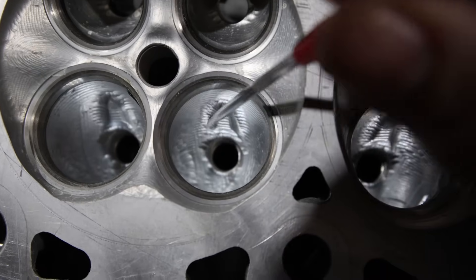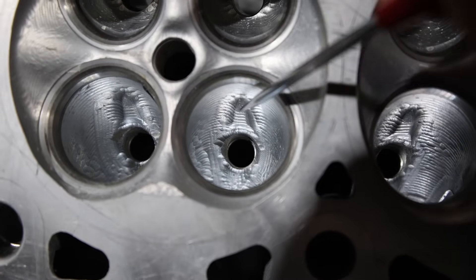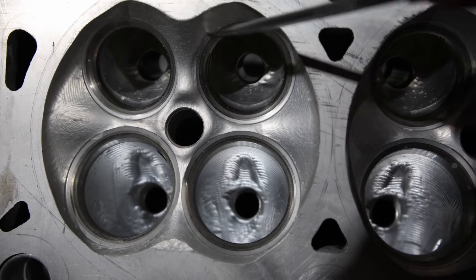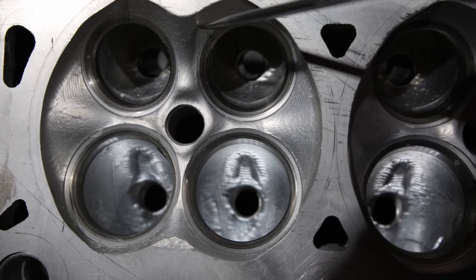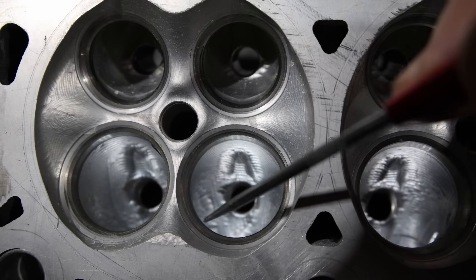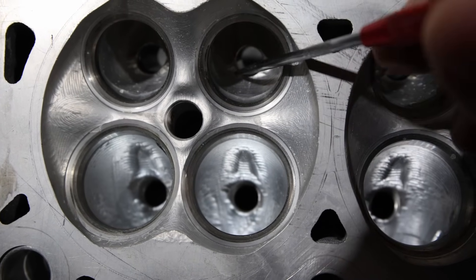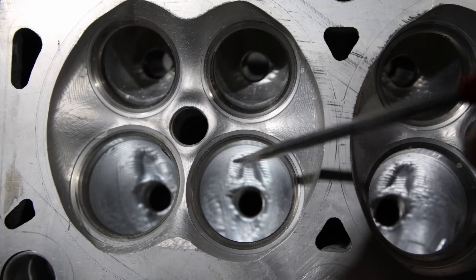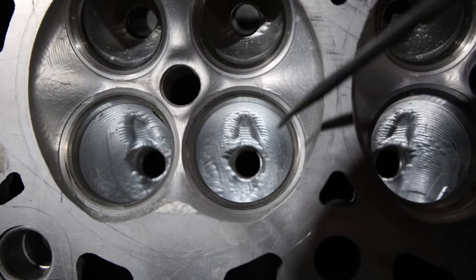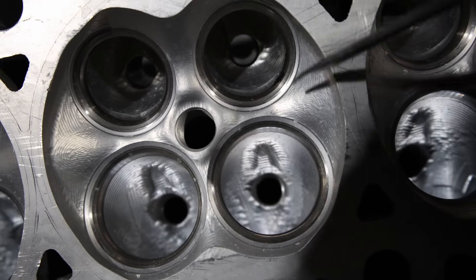The first thing you'll notice is that Ford put a swirl enhancer in here, CNC'd. The combustion chamber does not have a provision for DI, and that's something that makes this combustion chamber different than all regular non-Boss cars. They had a different combustion chamber. The port is CNC'd from the factory — this is the intake port; it doesn't have guides in it because I need to put guides in it to flow this thing.